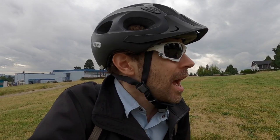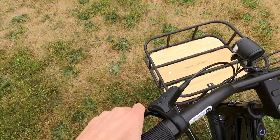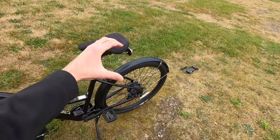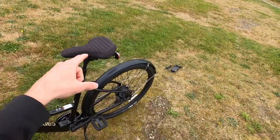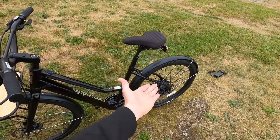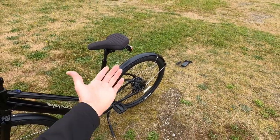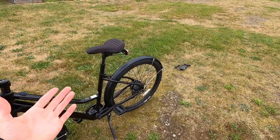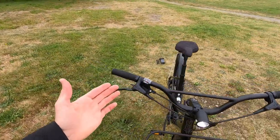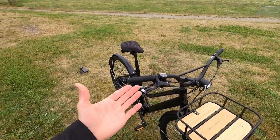If you're just coasting and the cassette isn't spinning, you won't get pedal assist activation. 40 pulse is pretty responsive. In practice as I've been riding it, it seems kind of normal — I start pedaling, it kicks on pretty quickly and shuts off pretty quickly, but not immediately when I stop. Because this doesn't have motor inhibitors on either brake lever, you just have to wait. I've had moments where I was pulling the brakes, still moving my feet a little, and the motor was still going because of those 40 pulse cadence sensors. For me, that was kind of a letdown.